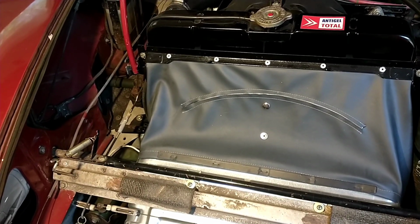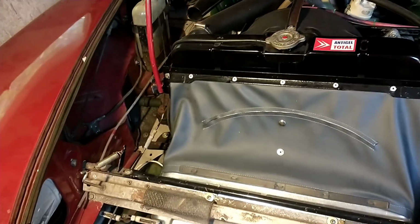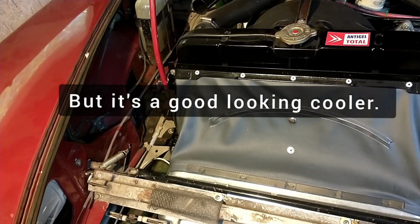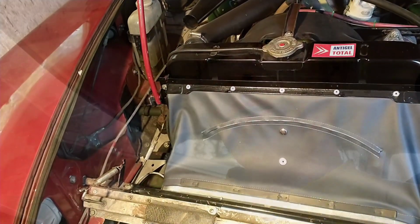You press the brake pedal and nothing happens, and then everything comes at the same time. So see what that is. Of course, it's due to air, but where does the air come from? I think we're gonna have a look at the height corrector next, because the car is still sinking pretty fast when parked. So yeah, that's what we're gonna do.